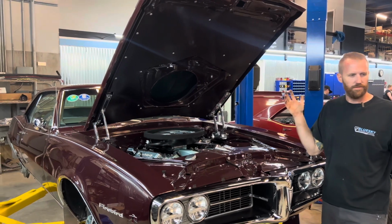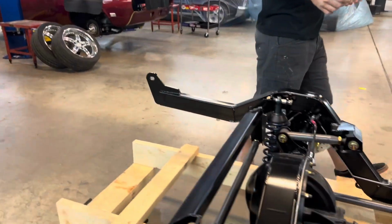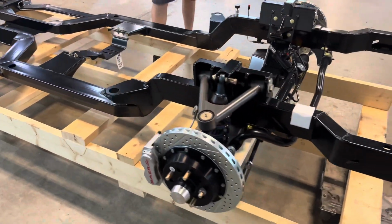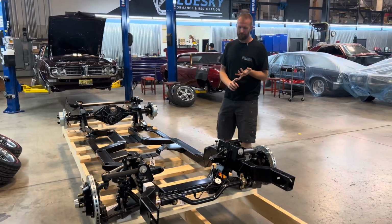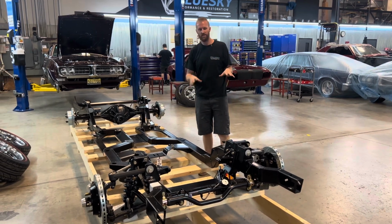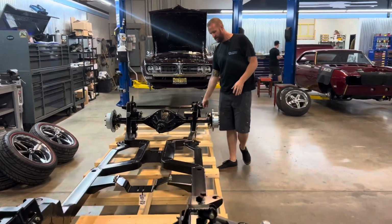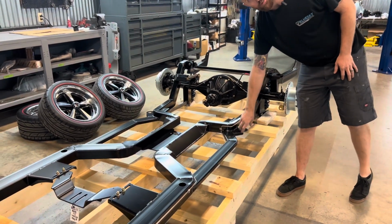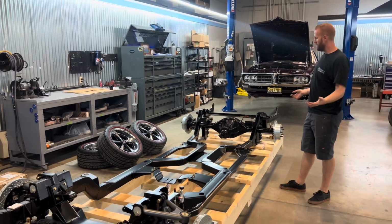our no-brainer go-to was the Roadster Shop SPEC Chassis. This is a full chassis that bolts into first-gen Camaros. They do make them for a number of other vehicles, second-gen Camaros and Firebirds, Mustangs. It's a full chassis that bolts into the car. This doesn't require any cutting of the floor pans, no welding, nothing. All you have to do is add a couple body mounts to the upper frame rail section, and add a bracket that bolts in where the original leaf spring bolted in, and now you have a bolt-in chassis